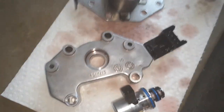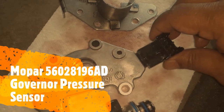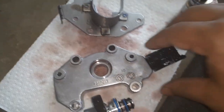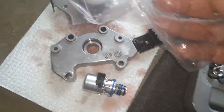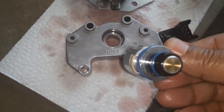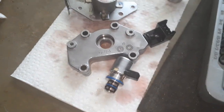I'll put the part number on screen and put it back in. Also, if you are doing your own maintenance, it's a good idea to replace this pressure sensor here as well — it's around $60-70. I'm going to leave it for now because I don't have any warning lights. If you get a warning light in the 1700 code range, which is a transmission low pressure or pressure issue, then you should replace that part too. Some people have commented that the new solenoid looks used because there's some transmission fluid in the bag, but these solenoids have been pressure tested at the factory before sealing — they are not used.